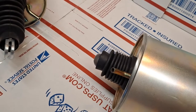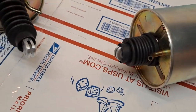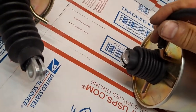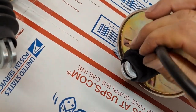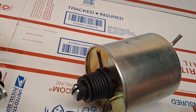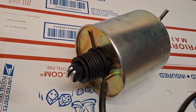These units should never be actuated by pulling or pushing down on the rods. That should never occur, because you would breach the seals internally. So I'll go ahead and connect my vacuum hose to the front portal. We have two vacuum chambers and seals in between, and for those reasons, we never want to breach the seals by pulling or pushing down on the rod that holds the clevis-designed bracket at the end.